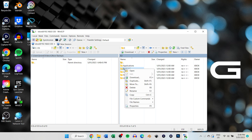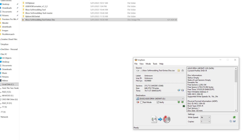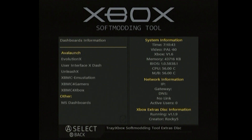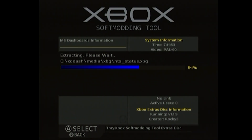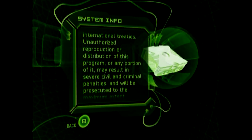Next, we need to reinstall the original Xbox dashboard, as this will be used to access Insignia. We'll need to burn a DVD called the Extras Disk — a direct download link for the ISO file is in the description. I'd recommend ImgBurn for disc burning duties. Pop in a blank DVD-R, select the file, choose a low write speed like 2.4, be sure to select the Verify checkbox. Once done, insert the disc into the Xbox, navigate to Dashboards, MS Dashboards, select Install and Yes to the prompts. I'd personally recommend installing audio too, since the dashboard has been eerily quiet since the soft mod. Once installed, remove the disc and reboot. Navigate to Applications and Xbox Dashboard — the OG dashboard will launch, and system info will confirm the dashboard version is still 5960.